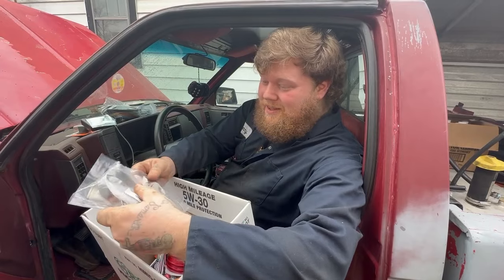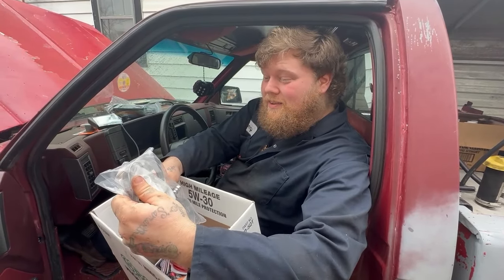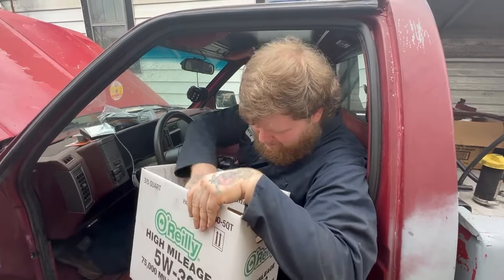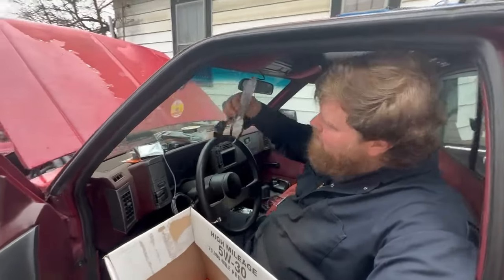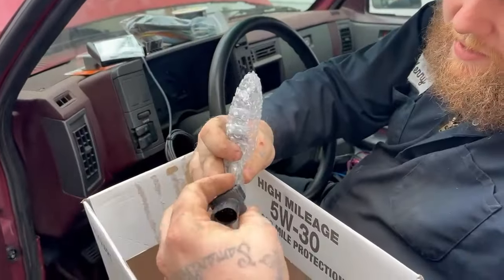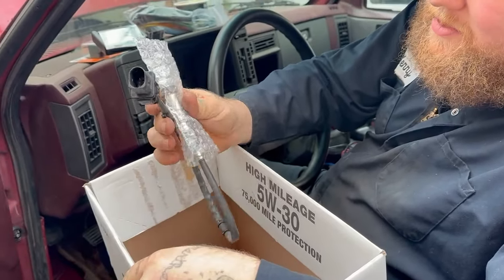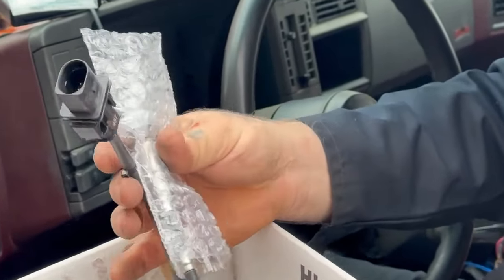But this isn't quite big enough for what I'm gonna do, because my exhaust opening is 3.5 inches, so that ain't big enough. I won't be using that, but I will be using the four wire. I believe this is a four wire. It's a wideband style O2 sensor. It's going to tell this sniper everything. So these are good to have.